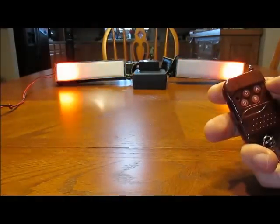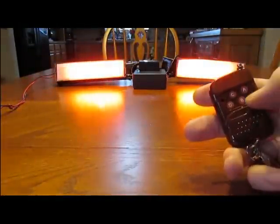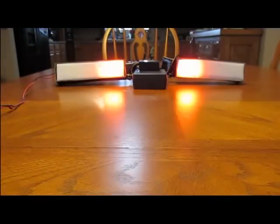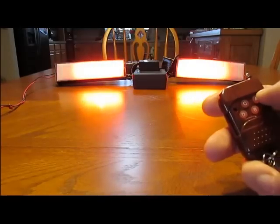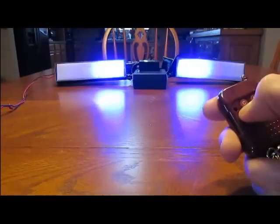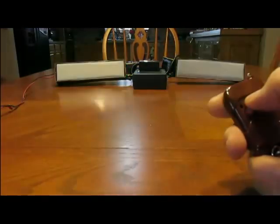Now if I want to go into color control mode, I hold down the B button for 3 seconds. The color control / speed toggle is always B, and when it's done it'll give me feedback. Alright, there's the feedback, it flashes multicolored. Now the speed control buttons were C and D, now they become color control. So I'll go color down first. Every time I press it. Alright, so blue is the first color, so I'll press it, it'll just stay on blue. So color up.